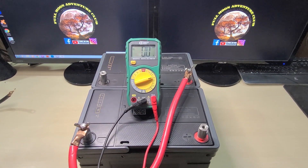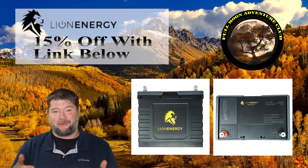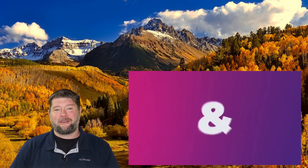I hope that was easy enough and demonstrates exactly how to double the voltage of any battery. This would work with six-volt batteries as well — it's exactly the same process, and you're going to end up doubling the voltage of whatever batteries you have. Two six-volt batteries becomes one big 12-volt battery, and two 12-volt batteries becomes one big 24-volt battery. Since I was using lithium batteries, the voltage was 13.5 and 13.5, so when we added them together it was 27 volts — but the same principle applies and it's very easy.